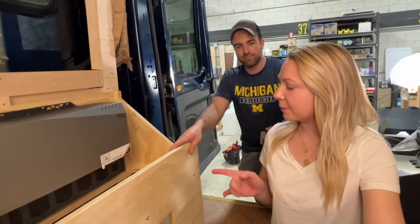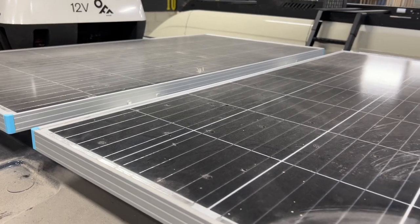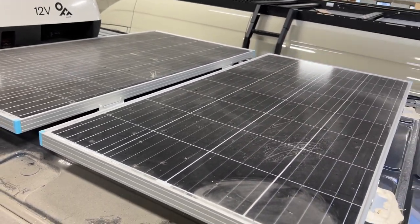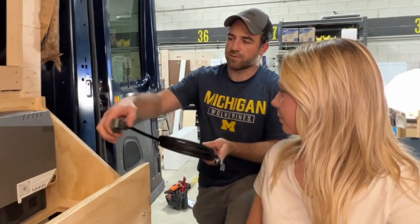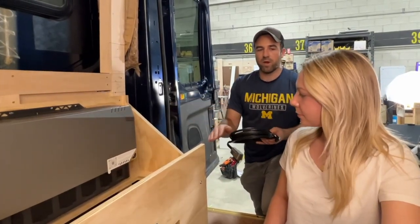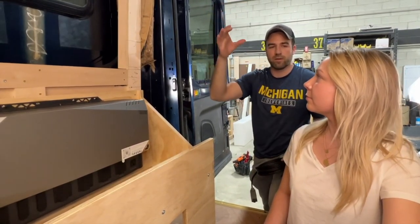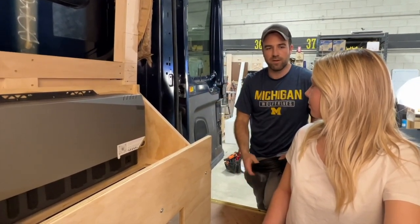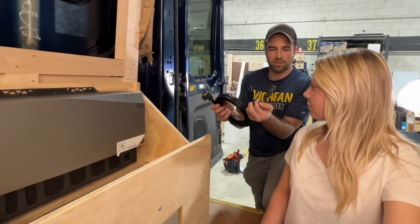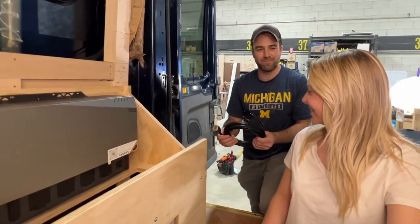So you said that the power hub can be charged with solar, and I have 350 watts of solar panels on my roof. Have you guys already connected them? We've not connected them yet. They are installed on the roof, but that's what this nice power harness that EcoFlow provides us is for. It plugs directly into the base of the power hub, and the wire harness itself gets run through a channel up the walls. We punch a hole through the roof and connect a solar gland so that it's weatherproof and you don't have to worry about rain or snow coming inside your van. And then these two ends right here plug directly into your solar panels. Oh yeah, I've dealt with these before in the Airstream. Yeah, MC4s, nice. Very cool.